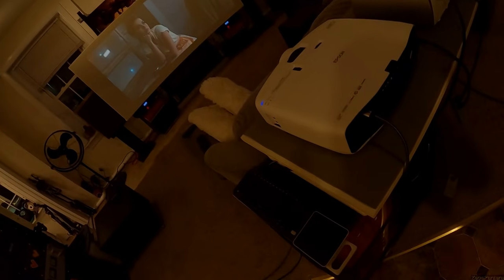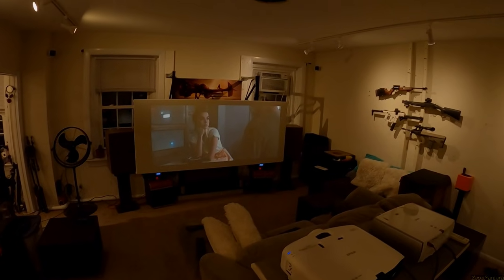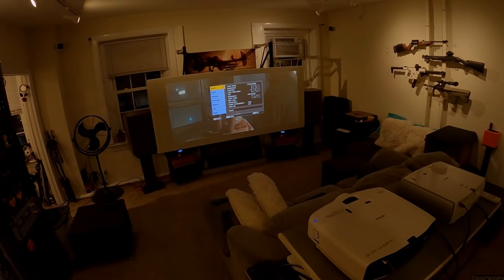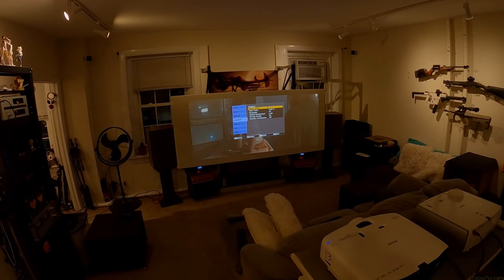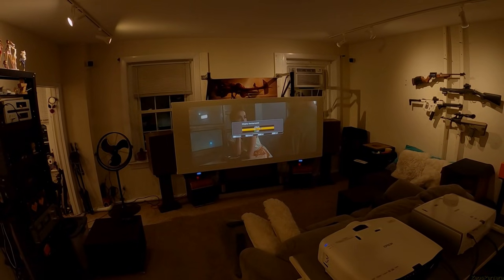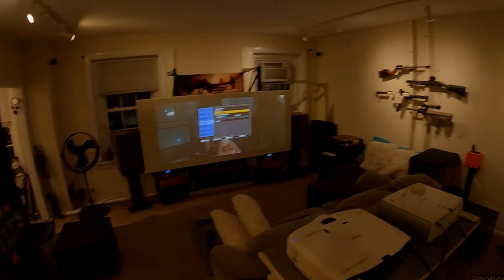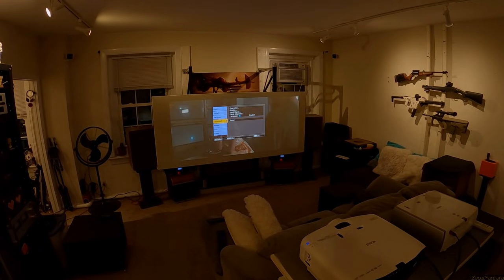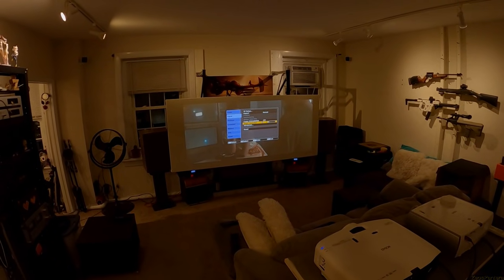You can instantly switch color modes. Also - super resolution: do not leave it at the default. Out of the box this projector is so badly configured. It wasn't just the color being too high - there were weird settings deep in the menus. In Signal settings under Advanced, there's noise reduction, overscan - which you don't want - and HDMI video range. If you set HDMI video range to 'normal' it crushes the blacks; you want 'expanded.'